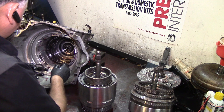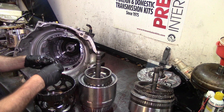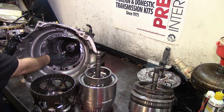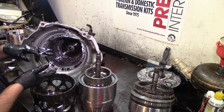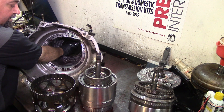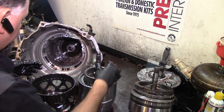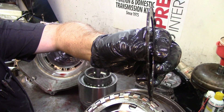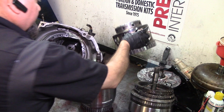Let me get this big sun gear or sun planet off. Here is the fiber washer — it's in good shape, it's not broken. This is the one that splines in here. I assemble the rear section first until that snap ring and then I put the transmission on the side and just shove everything in. If I have time, first we're going to need to get the parts. Look at that — something was misassembled in the rear section. The washer is melted — washer is melted.